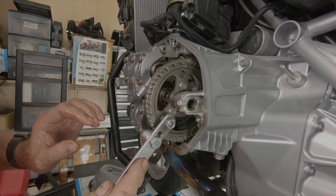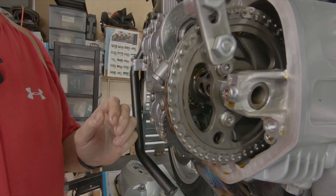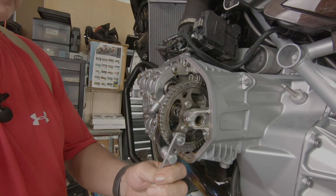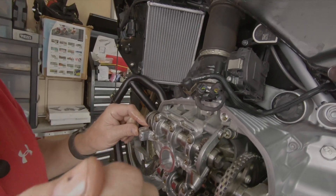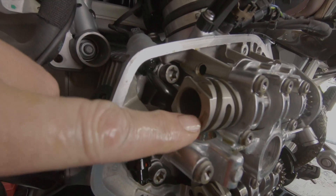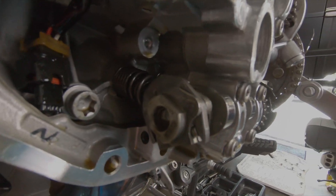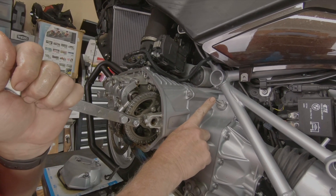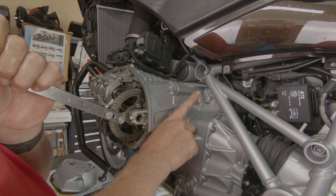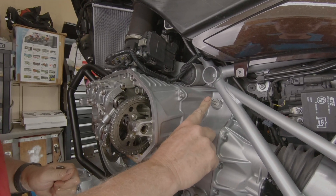Now I'm going to turn the engine over until I get this side to top dead center. This is an engine barring tool — a turning tool — and it's real easy to turn the engine over from this side. I'm watching the other end of the camshafts as the laser-etched mark approaches the bottom. I rotate a little bit more while pressing in with the pin for the top dead center locking tool, and it just dropped into the eight millimeter slot.